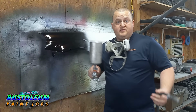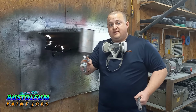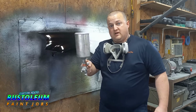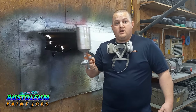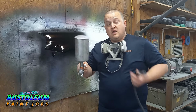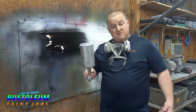Alright guys, so with these color shift chameleon pearls, they do tend to be a little bit more finicky than most of your other solid pearls. The big thing is keep your pearls agitated in your clear mix, so just shake it up periodically, that way they don't clump together because they do have a tendency to do that. Today I am shooting through my V-bore gun, it's a 1.4 tip, and I typically shoot between 26 and 28 PSI if you want to replicate my settings. But I'm going to get my paint mask on, and you're going to see as soon as I spray this, it's going to hit and it's going to start changing color. So let's get into it.